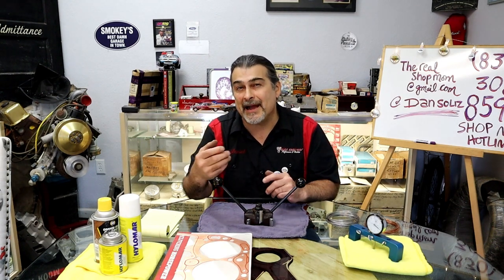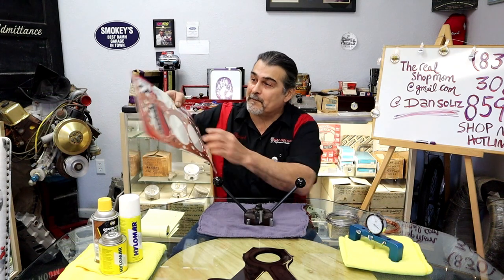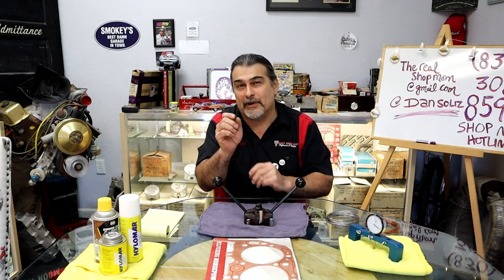Even though on the video you'll see I just pick anywhere across the top, it's not a stock block. It's an aftermarket block. There's a bunch of different reasons why I do it this way. Coming back afterwards to take an O-ring out, sometimes they'll be difficult to get out, and sometimes you have to get a punch and punch the O-ring out. If you have only this much space in between the bolt hole and the O-ring, it's not very forgiving. If I'm using a different area up here as opposed to right in there, and it gets damaged just a little bit, you have more room there. That area between the bolt hole and the O-ring is so tight anyway, and then having 2 pieces of wire land there, I personally, like I said, this is the way that I've been doing it.